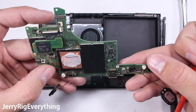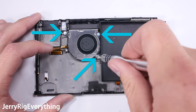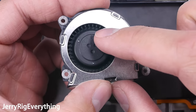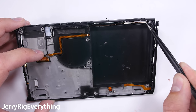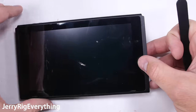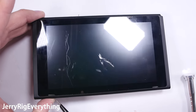Here is the main board, the brains of the device. The charging port is directly soldered in place and not replaceable, unfortunately, though the dock is pretty sturdy so wear and tear should be minimal. The last thing to come out of the frame is the fan with its three screws. This fan coupled with the large copper heat pipe and heat sink should do a pretty good job keeping the tablet cool, especially since it's only running at 720p when not docked.